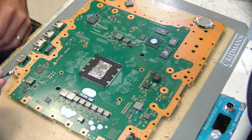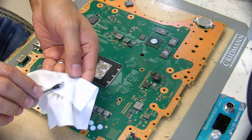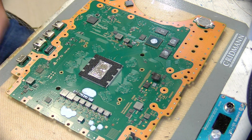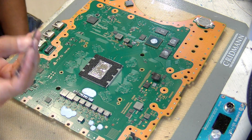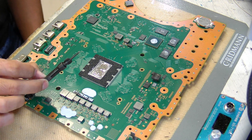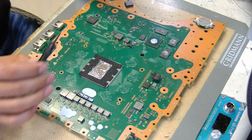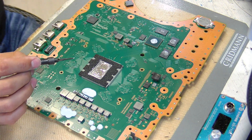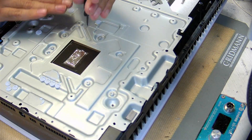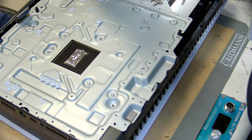With the wipe I just used — it's still saturated — I'll wipe all this off. You can see all that dirt. There's a little bit of liquid metal here, but it's not worth keeping; just throw it out. Now both surfaces are ready. I pretty much always reuse the customer's liquid metal and use the extra from the syringe as a supplement, but don't put too much. So the board has a thin layer, and the heat sink has a thin layer. I'm going to put one more drop on the heat sink so it spreads out completely rather than clumping in the center.